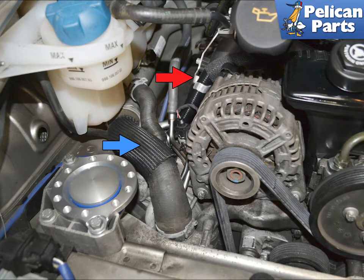Starting on the left side, or the one to three cylinder bank, the breather hose is connected to the cylinder bank by a squeeze clip. Unfortunately, the breather hose is located below two coolant hoses, indicated by the blue arrows. If you cannot access the breather hose, you will need to drain the coolant system to below this point.